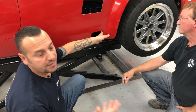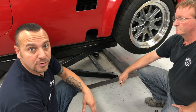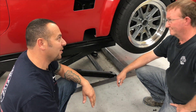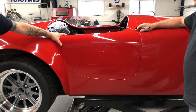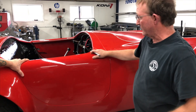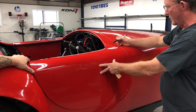Some body shops have done multiple of these — they know what to do. Our body shops know what to do. We just like doing it here and we set everything up so we can test fit our panels. That way we test fit our doors. We actually do our QC stuff as we build. We'll go through the doors. The doors are hung and you can see they fit in the hole. The door needs to be gapped — these pieces are made oversized. We always leave these oversized for the customer to trim, because you want to get the door in basically where you want it — latched, hinged — and then you go from there.